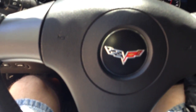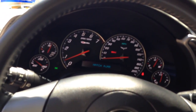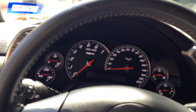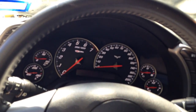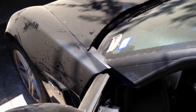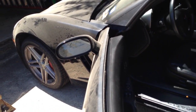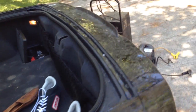That sounds very good. Before, when we put the new battery in it, it would start but it was like it was a weak battery or the starter was dragging. After starting probably half a dozen times it would not start — it was just dragging too much, then the starter smoked and you could smell it. We can close this out. We are done. It is running. Starter is good, battery seems to be good.